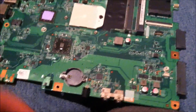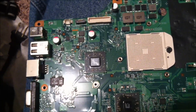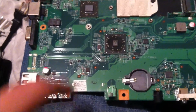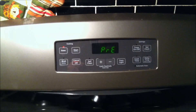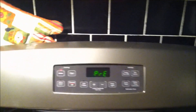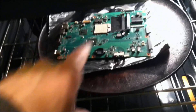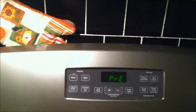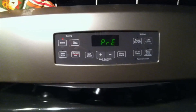On to the next step — you might want to take this component off here as well, just don't forget you've got to put the thermal pad back on there. Here's the next step: you're going to preheat your oven. You want to have your exhaust fan going — it's going to create some fumes. You're going to preheat it and then bake the motherboard at 385 degrees for 10 minutes. Put it in processor side up. This thing is going to be cooking, and it's going to have a little bit of fumes because of the board, but it's going to take care of your problem.